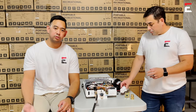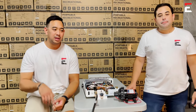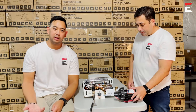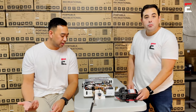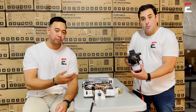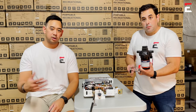If you've gone through those troubleshooting steps and the problem still isn't solved — whether it's clicking, not clicking, or the igniter stays on — here are some additional things to check. To make sure the water heater is properly activated, it needs a minimum of 25 PSI. That's usually standard with city water, but if you're out in the woods without city water access, we have a 12-volt pump that should supply enough pressure to keep the water heater activated and flowing. You'll need to connect it to a car battery and make sure the battery is good.